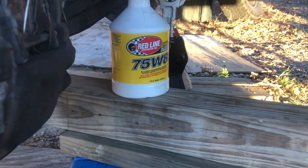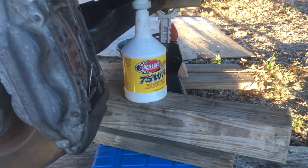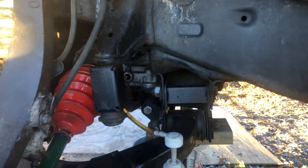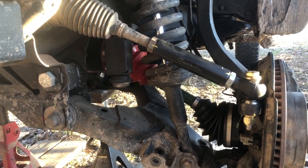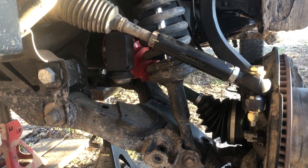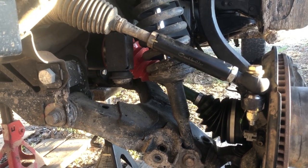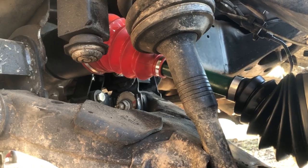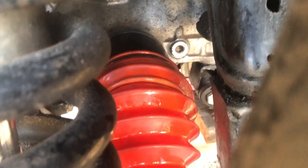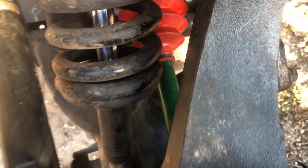After installing a new CV axle back into your front differential, make sure you top off the fluid when the truck sits level. I came to realize after letting the truck go back and forward a little bit on its own wheels that the boot actually sits right within the measurements, so I didn't have to change the length of the boot. The project ends by removing the air hose from the boots and then taking a test drive.